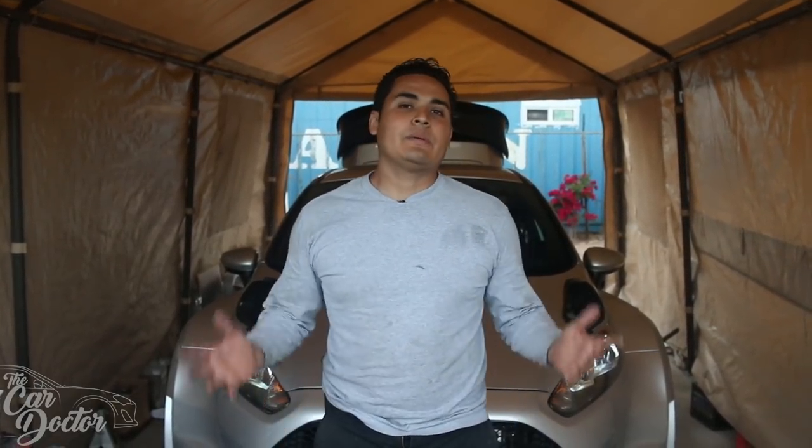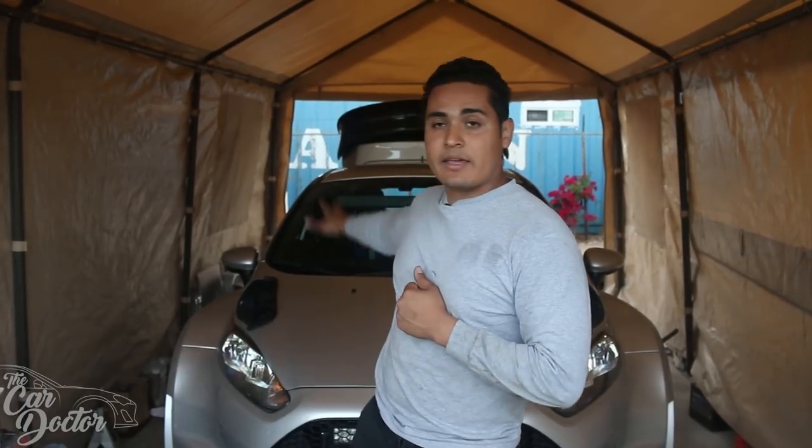What is up YouTube, Johnny B here again. Today we're gonna be bringing you guys some video on the Ford Fiesta ST — we're gonna be doing some more mods to it. We're doing an mSport brake duct kit. It comes in nice little pieces that hold the brake ducts on the actual fog light area. There's a fiberglass piece that separates it into two, and you have two smaller, about one-and-a-half-inch hoses. Instead of one big three-inch hose taking up all this area, the two smaller hoses sit nicely around the frame and scoop behind the wheels to feed air to the brake system.